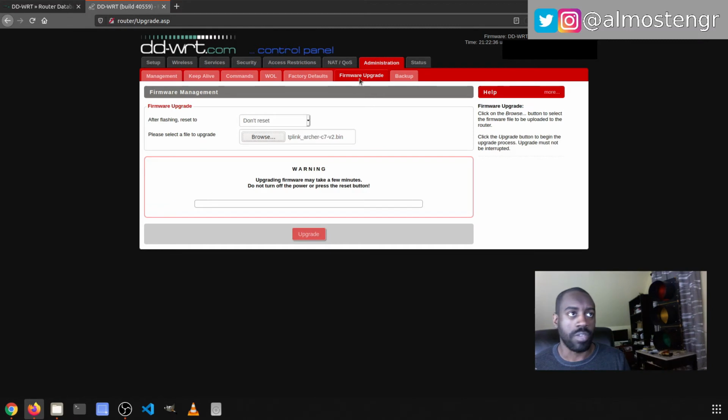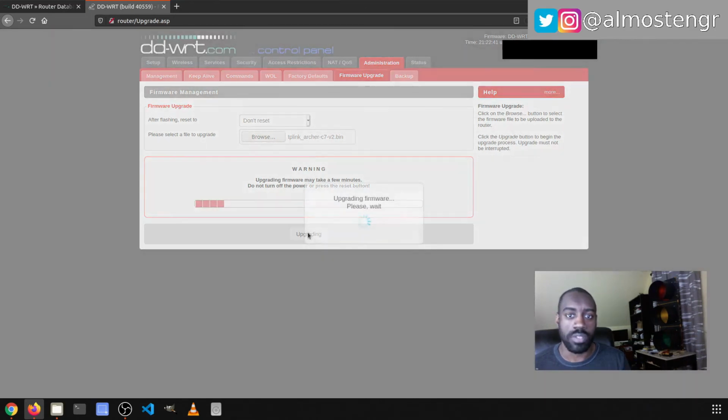All right, so then go back to the firmware update tab, select the firmware file, which I have done, and then hit upgrade. It will take some time for this to work. For me, it's probably taken about maybe 3 to 4 minutes for it to do a firmware update in the past. One thing you want to also note is that you can look at the version number in the upper right of your window to make sure that it has changed, as well as the date of that firmware release has also changed once you do the update.